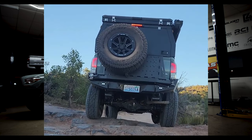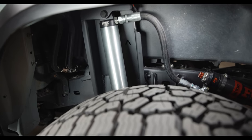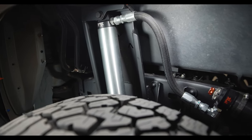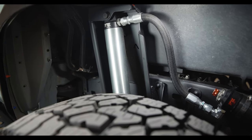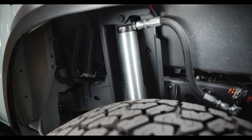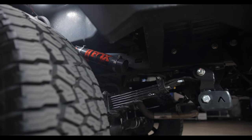One of my favorite things — the rear end. One of our favorite things to do on the rear of a Tacoma is the Archive Ultimate kit. It comes with a shock relocation kit and a cross tube between your new hammer hangers, and it's perfect if you want to run a 12-by-2.5-inch shock on the back. The Archive Ultimate kit costs $1,700. We also put in Dobinson's rear leaf springs, L59-112-R, which is a 1,200-pound rated spring at $810.